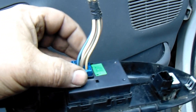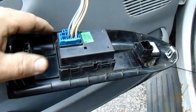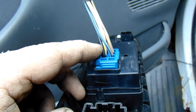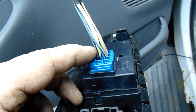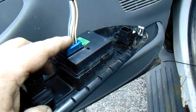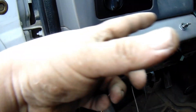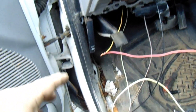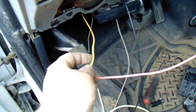So we got these four wires here. The four wires in the back of this connector - we know where these go because of the same colors as the wires that go down to the motor. The only ones we don't know are this blue with a black stripe and a solid black. I think it's a pretty safe bet that solid black is the ground - I unscrewed it from the body on that truck, it had a bolt right down here where it's grounded. So that leaves this wire, the blue with the black stripe - that's got to be power. In that truck it runs up in here and splits off into some harness, so I just cut it off. That left it too short, so I soldered on an extension with shrink tubing - this yellow wire is now that blue wire.